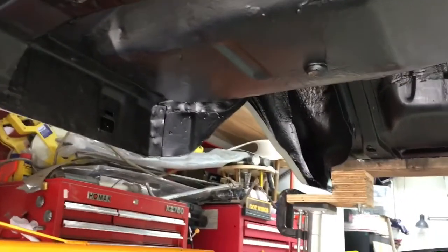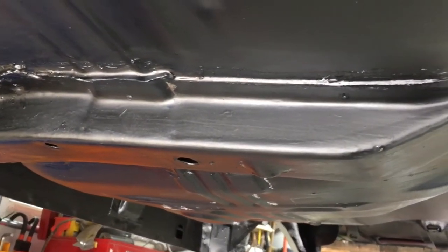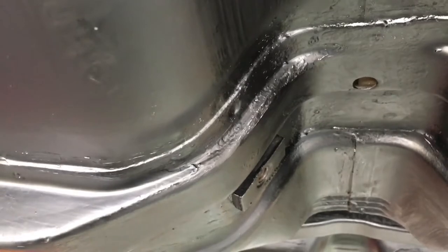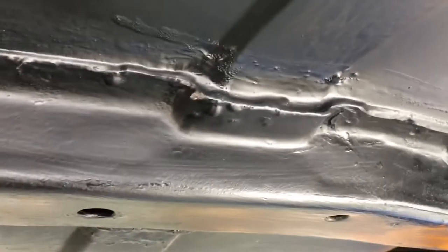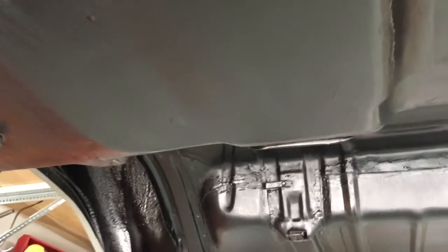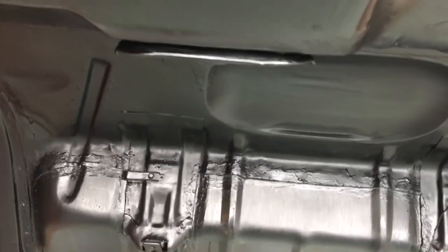After the sheet metal welding to the struts, I went ahead and also decided to use seam sealer, automotive seam sealer, to tighten up everything. The bottom of this thing can actually take a lot of moisture, more so than the original construction, and nothing's going to get in and sit in there. There are holes on the low spots in case it does, but I took away all the openings between the sheet metal and the struts and seam sealed that, then gooed the whole bottom with that rust encapsulator, which bites on to paint, primer, bare metal, everything.